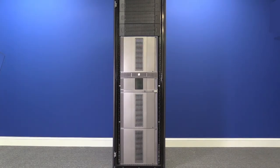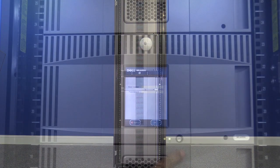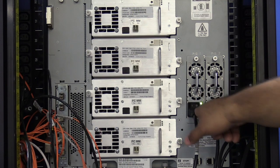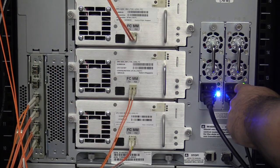If you have expansions both above and below your control unit, there are some extra steps that must be taken to complete the replacement. Before any of these steps are taken, the first thing you will need to do is power off the library once you have gotten approval from the administrator that downtime is ready and all tapes have been vacated from the machine. Hit the power button on the front of the library one time and wait for the library to power itself off. Once this is done, go around the back and flip all of the power supplies in the control unit and all expansions to the off position.